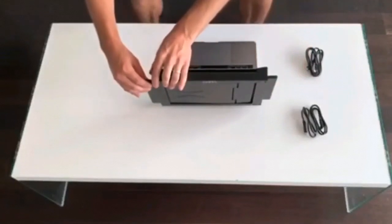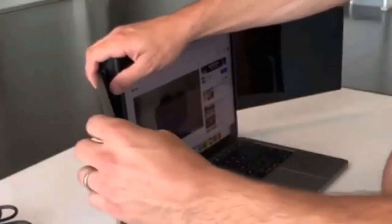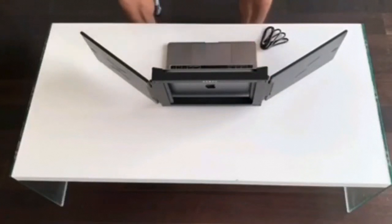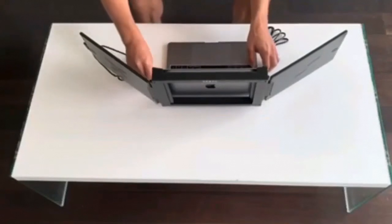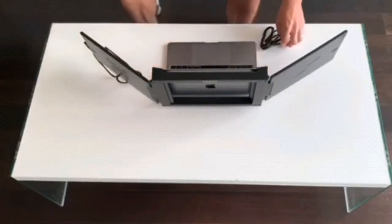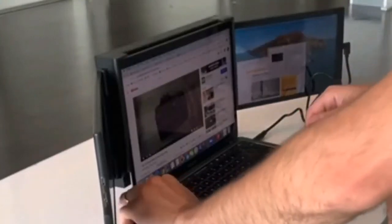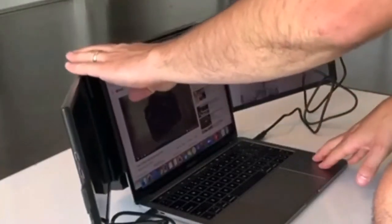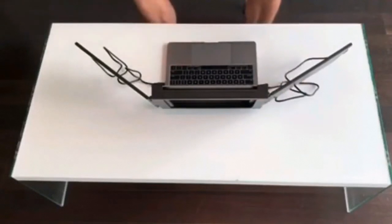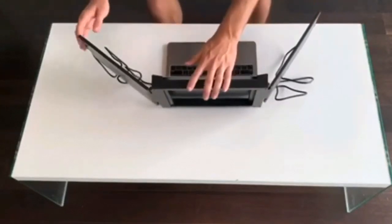Holding the top corner of the bracket with one hand, pull the screens out one at a time. Then tilt each screen to your desired position. Now it's time to plug it in. Plug the 90-degree end of the USB-C cable into the USB Type-C video and power input of the Tri-Screen. Plug the other end into your laptop. Then repeat this same process for the other screen and you're all set. Note that the right screen input layout is flipped for the screen on the left. Feel free to adjust the angle of the screens up to 180 degrees.